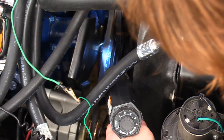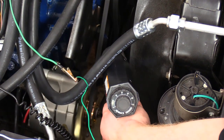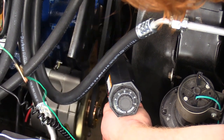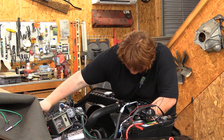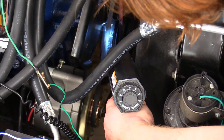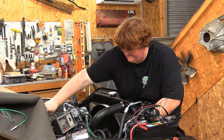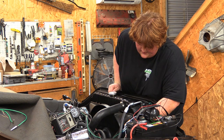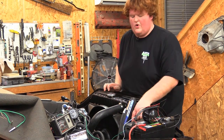We are right at 22, 24 degrees. I'm gonna pick some RPM up. It likes it. Now, what I wanna see. Got a little bit of spark knock. I think that's what I'm hearing. And also our timing staying a little bit high. We're now at about 26 or 28 degrees, somewhere in there. So I think I'm gonna pull one or two more turns out of it.